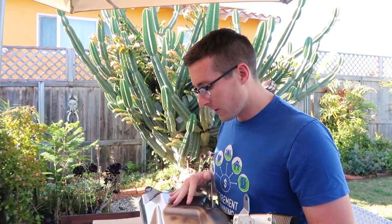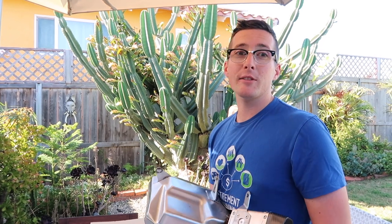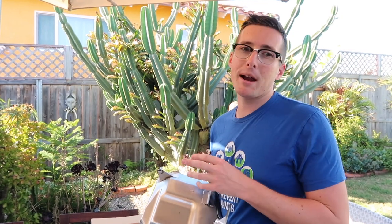So at this point, I just got home from work and I'm commuting on the bike right now, so I actually have to wait for it to cool off before I touch it. I think this video is going to span over a couple of days, because when you install this, you have to let the motorcycle do an adaptation process. For that, the bike needs to be stone cold, and I'll just let it sit overnight. I don't know the exact parameters, but I'd imagine that the water temperature's got to be pretty cold to activate that adaptation process.